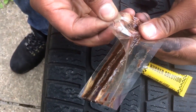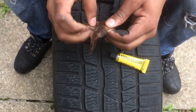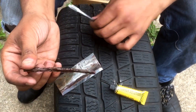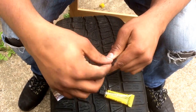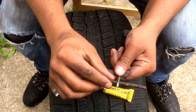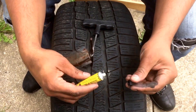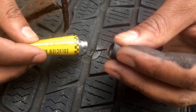These little sticks are very sticky, and they should be — if they're not very sticky then they might have dried out and you're going to need to get new ones. So we've got this ready. What we're going to do is insert this strip through this tool right in the middle like this. I'm going to keep that there for now and pour some of this rubber solution down there. This solution can dry quite quickly, so put some in there.